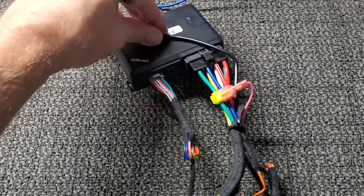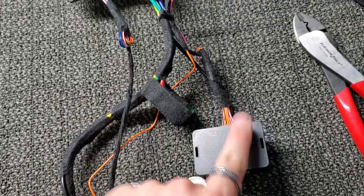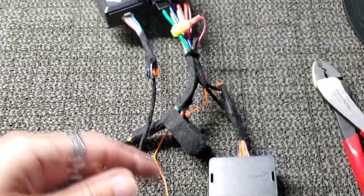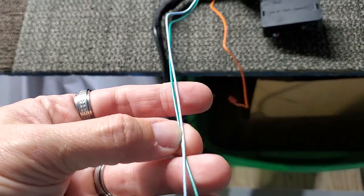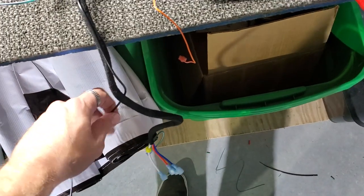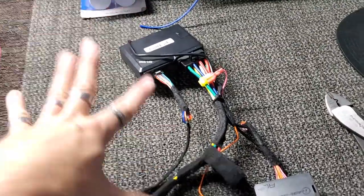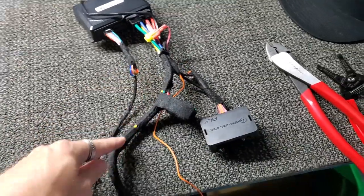This is our brain wired up right here. This is your secondary harness and your main harness. This is the data port coming off for the ALCA. The only two wires you need to use off of here is an orange wire, which goes to data on the purple wire of the Trailblazer on the OBD-2 plug, and then this pink wire, which goes into your ignition wire — I tap it in here just to make it easier if it has to be unplugged. Your blue with white stripe is your brake wire, your green with white stripe is your parking light negative. Your ignition harness has all your ignition wires, and down here is your ground wire, which has to be self-tapped into the frame underneath the dash.